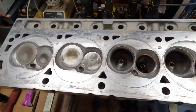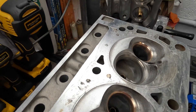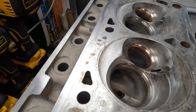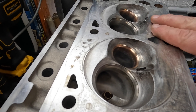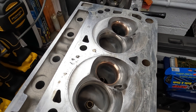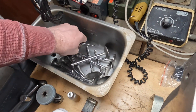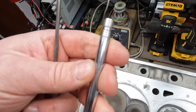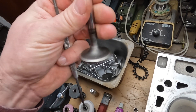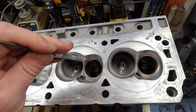Big surprise: all of these exhaust seats have been retrofitted — I'm pretty sure it's like a beryllium copper seat. That's not standard from TFS back in the day for these heads, so these heads have been worked at some point and had copper exhaust valve seats installed. All the valves — I cleaned them up and bead blasted them — they're all Manly valves. I don't know if Manly was the valve supplier for Trick Flow back in the day, but the valves look great, basically brand new other than all the carbon especially in the exhausts.